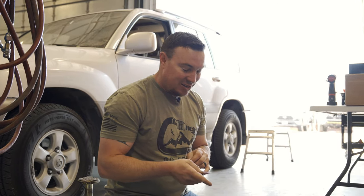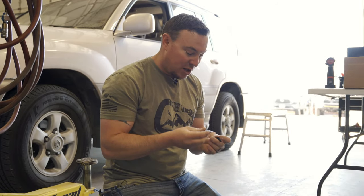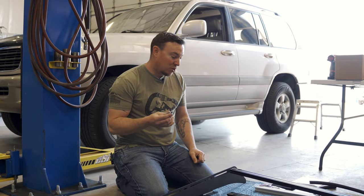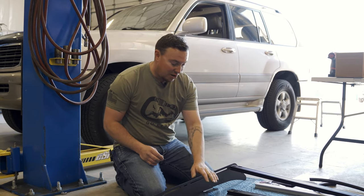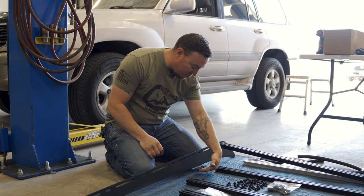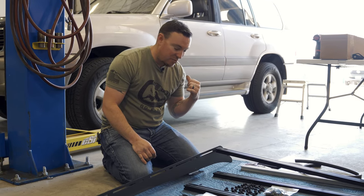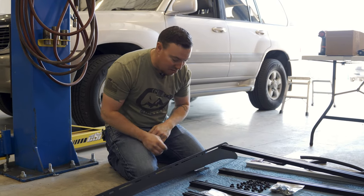So I've opened up the bag containing the bolts that hold the cross pieces to the side rails and I'm getting them all prepped — putting on the flat washer and some Loctite so they'll be ready to go for assembly. We got all our T30 Torx bolts prepped and ready to go. We're just going to install these hand tight on our cross pieces. They're going to install on the smaller slots, not the wider ones. And if there's a mounting foot next to the smaller slot, you might want to wait on that one, because it'll get in your way when you're trying to mount it to the roof itself. So we're just going to install these where there's not a mounting foot right now.